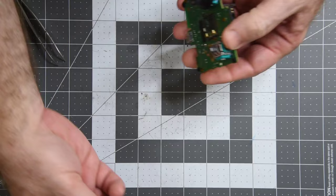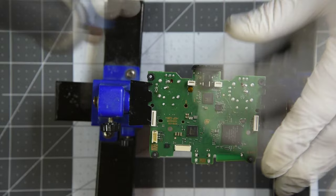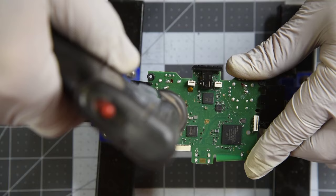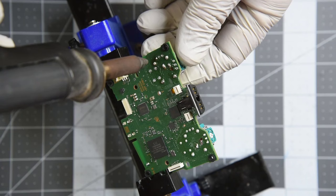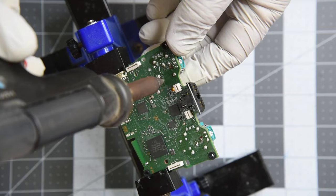I'm pulling the knobs off of both joysticks, but I'm only going to remove the left one from the PC board. I'm putting some fresh solder on all the pins — maybe help a bit with the removal. Going to use a vacuum desoldering tool to unsolder the joystick pins. It's taking more heat to remove the solder on this PS5 controller than on the PS4 ones I have done — definitely more difficult.